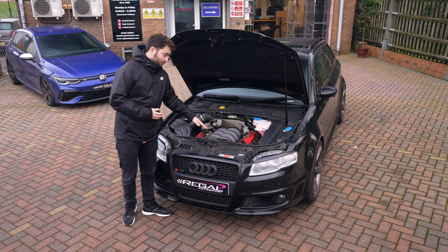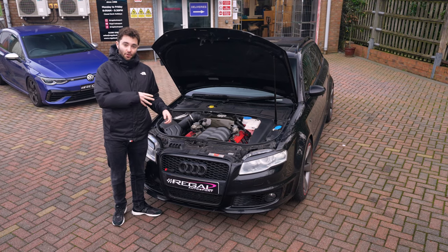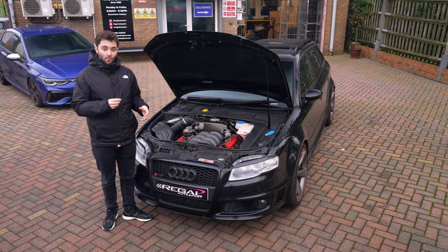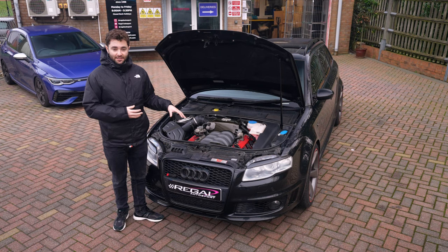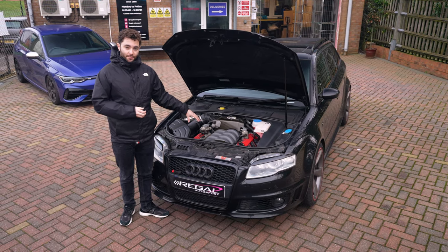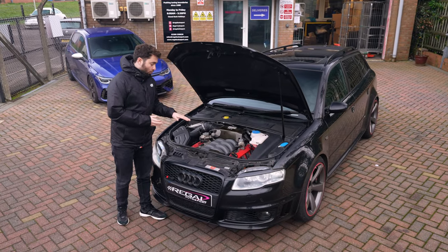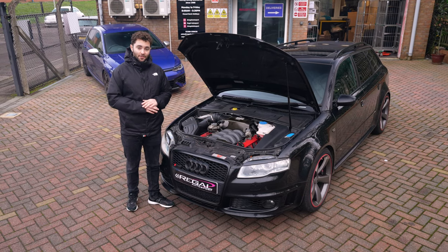Because on this car you don't have the indirect injection, that fuel is no longer going through or past all those parts. That fuel would usually have a cleaning effect, so it wouldn't allow all of those carbon deposits to build up, which get breathed through the cylinders, through the breather system and all that kind of stuff. As it goes through the intake, it cools down on those parts and solidifies, and the indirect injection would usually not allow that to happen. Because of the direct injection injecting directly into the cylinder, you get no cleaning effect whatsoever.